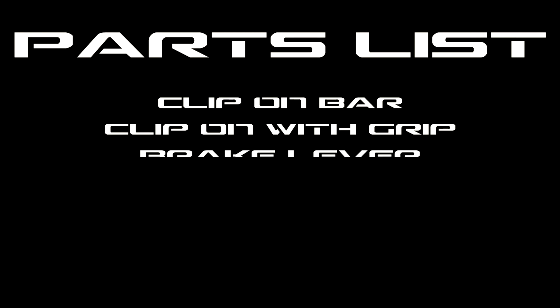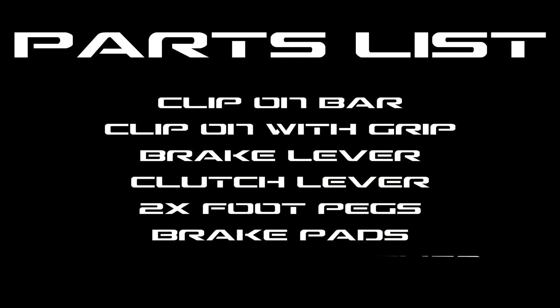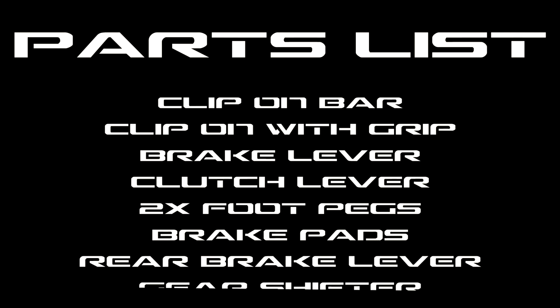So when it comes to a spare parts list, it is really a right of preference as to what they'd like to carry. What I suggest to my team is to have a clip-on bar with no grip, and that one's for your throttle side, a clip-on bar with a grip for clutch side, a brake lever, a clutch lever, 2 foot pegs, a spare set of brake pads, a rear brake lever, and a gear shifter.